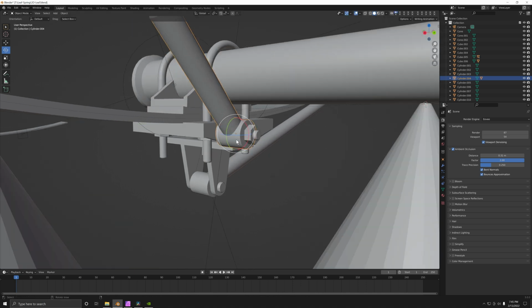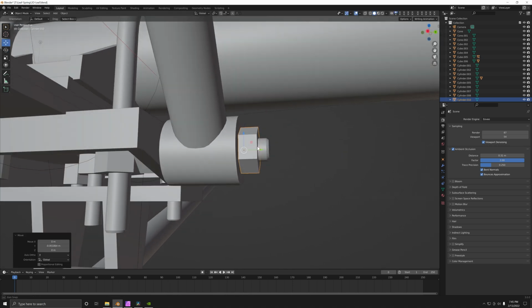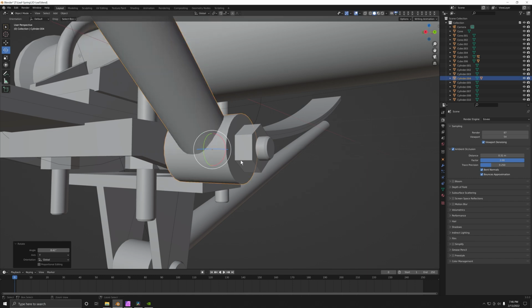So you want to make sure that you use some type of thread sealing compound, get it a tiny bit tight so the bushing has a little bit of tightness in there, but you don't want to get it so tight that it's binding this guy up. It's very important that this guy can move freely.